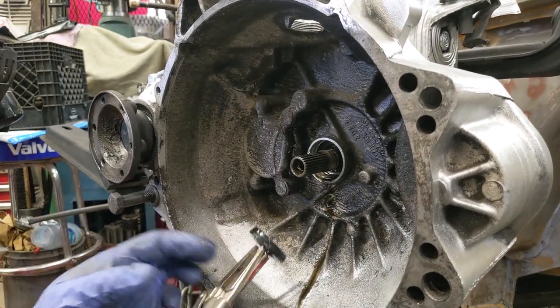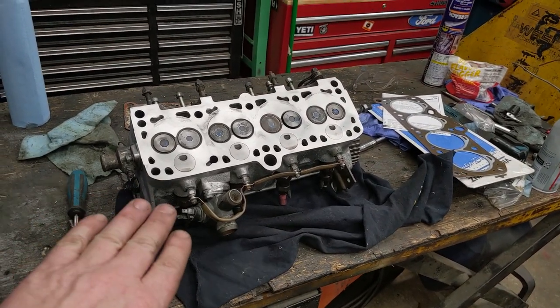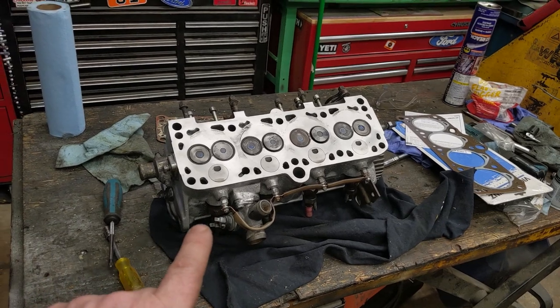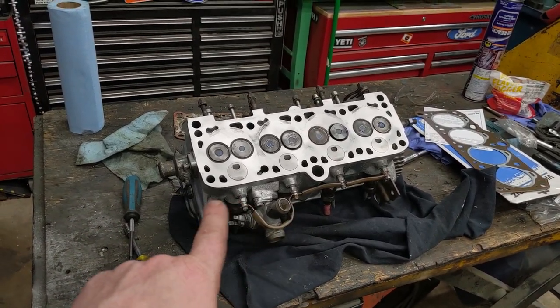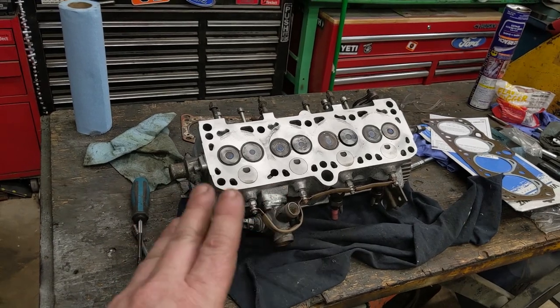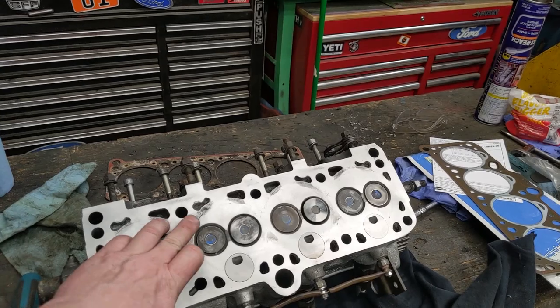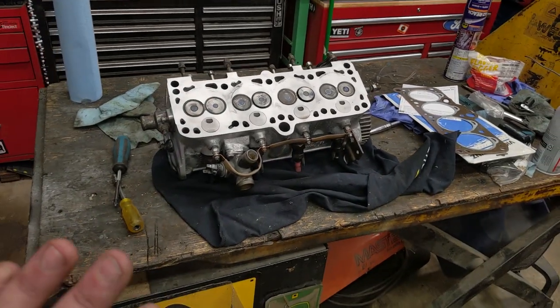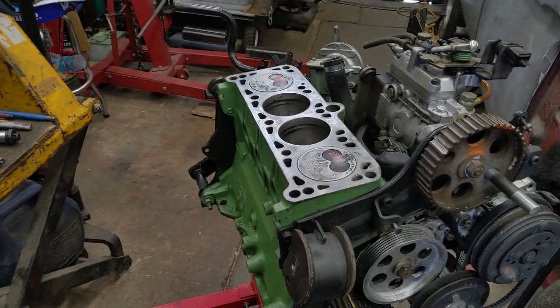And we're out. So the cylinder head was pretty warped, and I straightened it out and straightened out the camshaft. I did a completely separate video on that if you saw it. And then I sanded a deck to the top so it was bent back and decked. These little marks are nothing. They are just stains. So it is flawlessly flat within under half a thousandth. We got a new head gasket, ready to assemble everything.